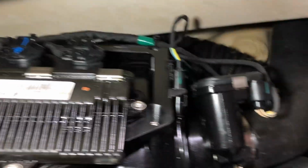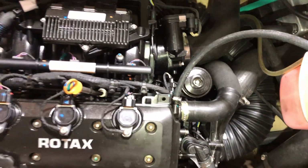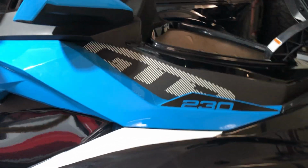Here you can see the routing of the air intake. It just barely makes it through all the hoses and such. Another item to point out is that there's a special clamp for that corrugated piping. It's actually a spiral design. I reattached the plastic. One thing I didn't mention is that it is held in the front by 2 screws. Also, once I got everything situated, I have been going back in with zip ties and cleaning everything up, securing the wiring harness and such.